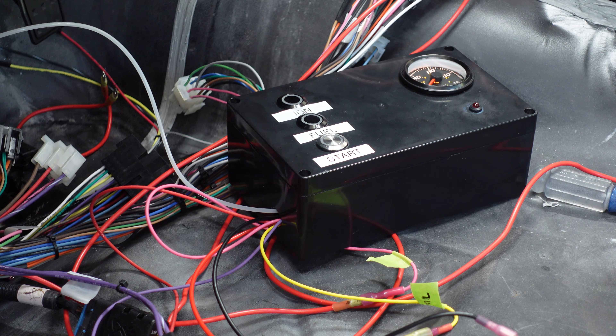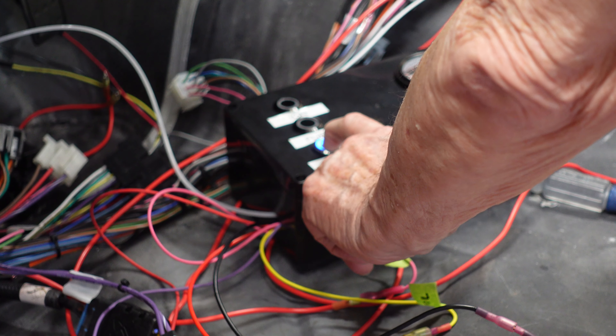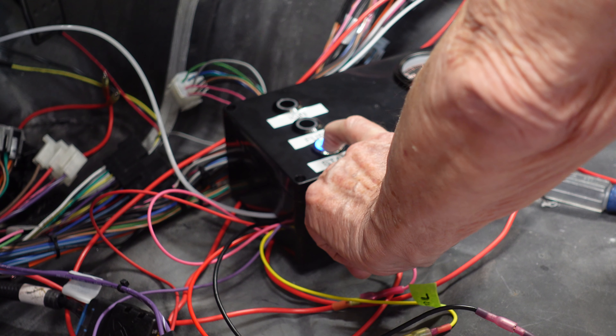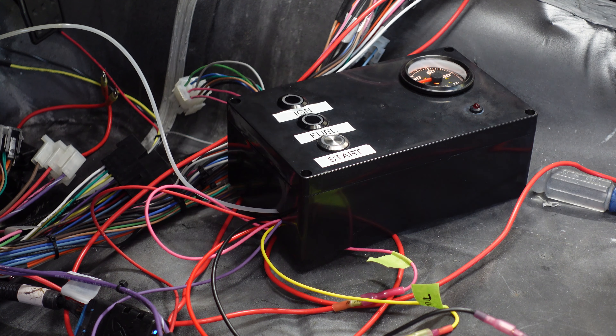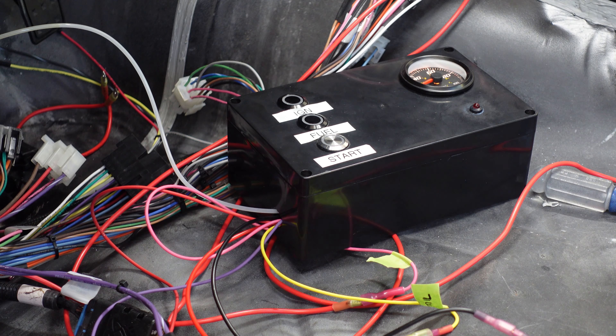Yeah, we see oil in that line — it's making its way up there. It's moving. It hasn't shown up on the gauge yet, but I can see oil coming up this hose here, so there's definitely oil pressure, it's just not showing up on the gauge yet. All right, we got oil pressure that time. What do we got — 20, 25 PSI? Yep, we got oil.